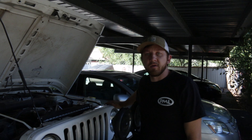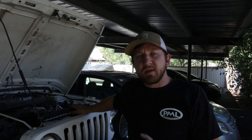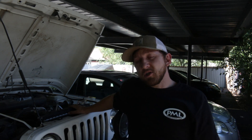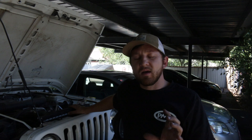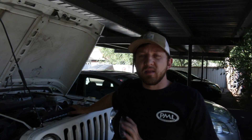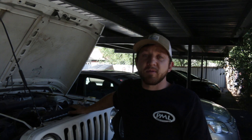The fan is now in and we are ready to test. Let's get everything set up — let's get our anemometer in there and we'll test it on startup. The clutch should be cold, so we should get a fairly accurate reading of what it's going to be like when it's cold, but the engine is warm, so it's probably going to come down pretty quick. The engine has been sitting for about two or three hours. Let's do some testing and see what happens.